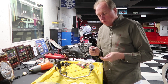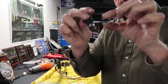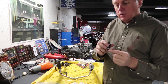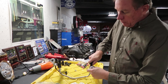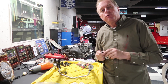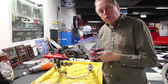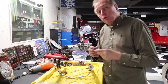We have removed all of the old fuel injectors. There's a little snap ring on each one that holds them in place so the pressure of the fuel does not push them out. They have an O-ring that holds them in and will just slip in and out. We found a set of refurbished, fully tested fuel injectors — a set of eight — on eBay for $75 with a five-year warranty on them.